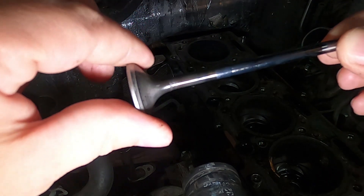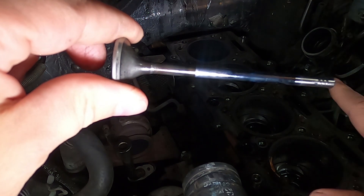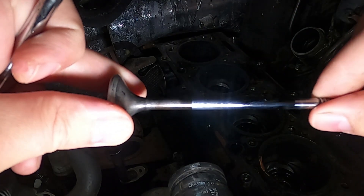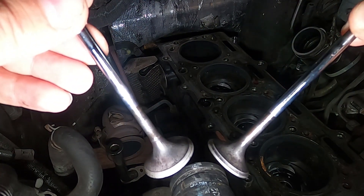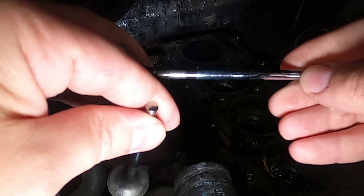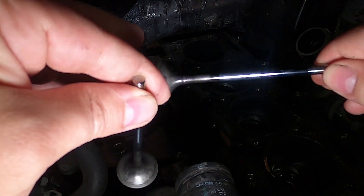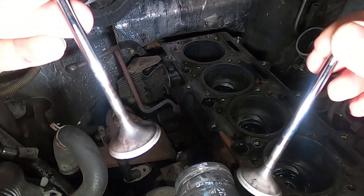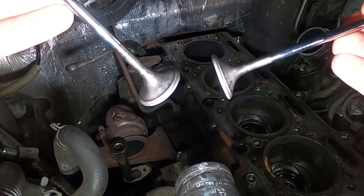It's not every day that you get the chance to tear an engine all the way down to the block and replace anything you don't like. There was a college study performed on these valves, and it appears there's a repeat failure method — heat stress, possibly friction heat. In diesel fashion, what they do in the Duramax, Power Strokes, and big diesels is put in Inconel valves, so that's exactly what we did.